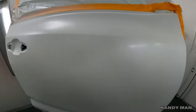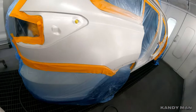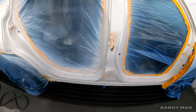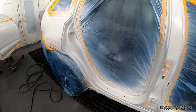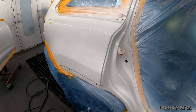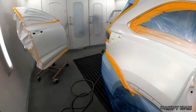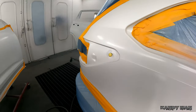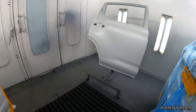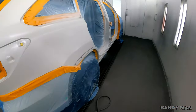We went ahead and worked that blend and put a coat on all the parts and panels we're working on. Do everything the same. The 920 and any of the base clears have a little bit of a yellowness — that's why I don't use them when I do silver blends because I've seen that they darken the panel. So I don't use a blending base clear except when I'm diluting the base out, and I don't take it to the end of the panel. I put it on all the panels to be consistent and make sure once these things go on they have the same thing done to all of them.